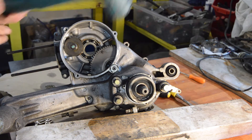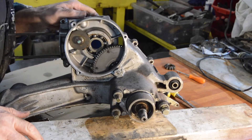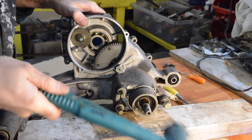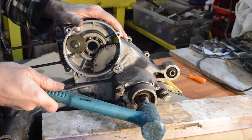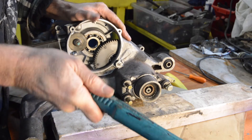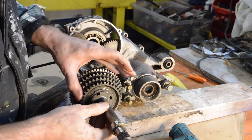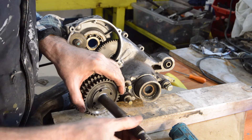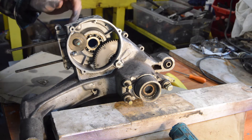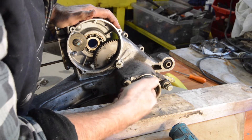It shouldn't really be that tight — famous last words. We're going to just give it a tap. It sounds loud but I'm just tapping it. And there's your gearbox — well, your output shaft. All of which looks in good condition, so we'll check all that later. That bearing has no in and out play at all and it's smooth.